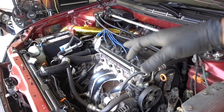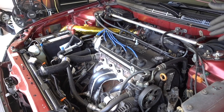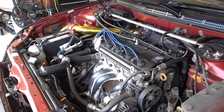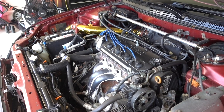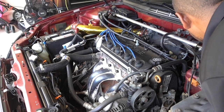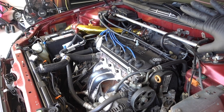Battery is being connected. Check and double check because it's fuel — if you spray some fuel somewhere in there, clean it. Throw water or soapy water on it. Make sure there is no fuel around and make sure everything is clean. Fuel pump is being connected. Now I'm going to prime the system for about 10 seconds so we can get fuel back into the line and injectors. Then I'm going to start the car and check for leaks. Now that I've primed the system, I'm checking for leaks and I'm ready to start the car.